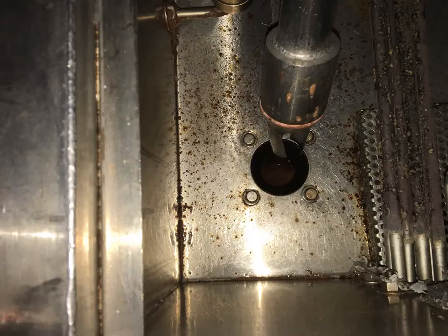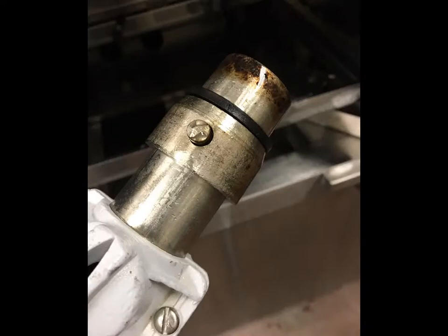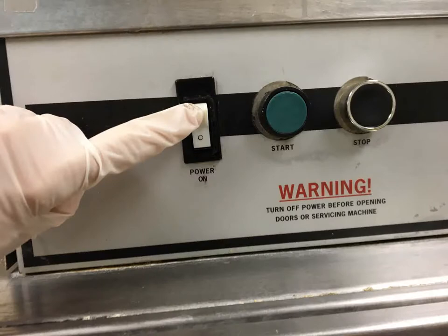Assemble the machine, making sure the two plugs are properly seated in the drains. Check the spray nozzles for O-rings. If one is missing, sometimes you'll find it inside the collar in the washer. If any rings are missing, you may proceed but notify the head cook. Switch on the machine — it will take at least 5 minutes to fill the tanks and bring them up to operating temperature.